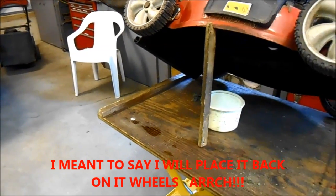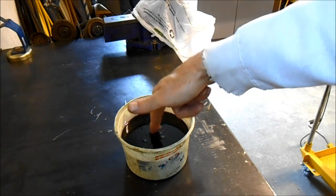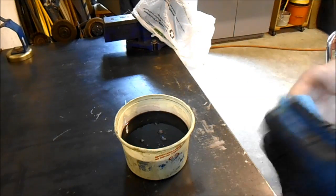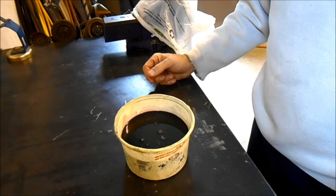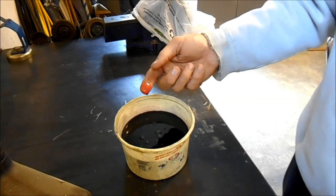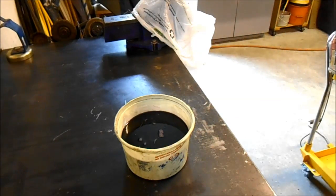I'm just going to tilt this lawn mower over and drain the oil into that cup, and we're going to have a look at the oil. So what do you think that is, tubes? It looks like transmission fluid mixed with motor oil. But is there a possibility it's royal purple or something like that? I really can't see somebody putting royal purple into a lawn mower, but then again I can't see somebody putting transmission fluid into a lawn mower. This is transmission fluid — new transmission fluid. Looks kind of the same as what came out. Whatever it is, I don't think it belongs in a lawn mower, so this is going to go into my strange things I find.